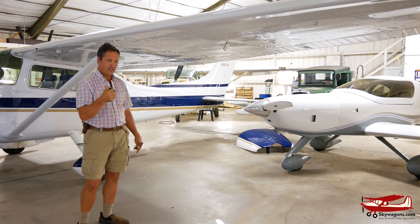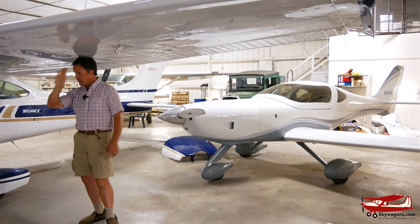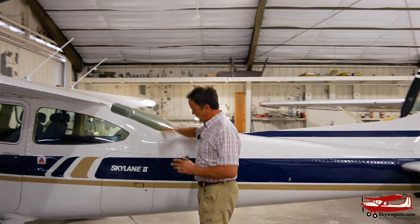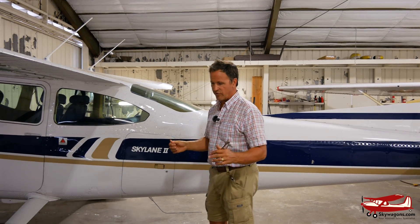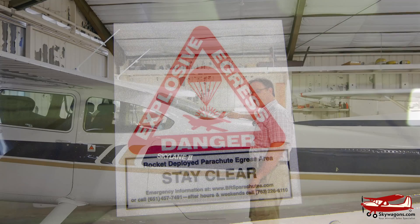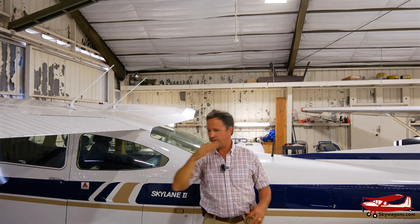The owner wanted the plane to fly very slowly but also be practical at high-altitude cross-country speeds. It's got an angle of attack indicator on the dash — a holographic one. Also, it's got a BRS ballistic parachute. If the calamity occurs and you're going down, you get it below 130 knots, rip the cover off inside and pull the chute — it blows the rear window out. It rips a cable up to the main spar attach points and the whole plane dangles from the parachute and lands softly.